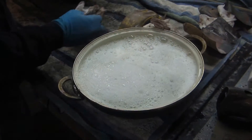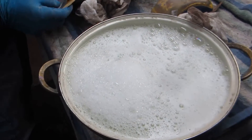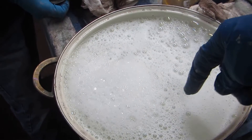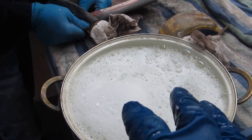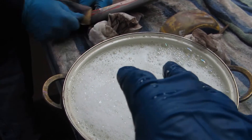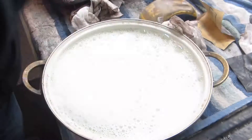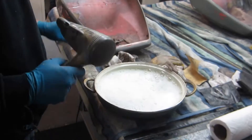Another great tip: every once in a while, when you're almost finished sanding, change the water. Put some clean water in — all the sediment from the primer, all the stuff that goes in the sandpaper, winds up in there and you're just gulping it back. One of the things I've seen guys do in a body shop is use a big bucket of water so the stuff sinks further down into the bucket. I've tried it — it is very inconvenient. So I just change it out every once in a while.